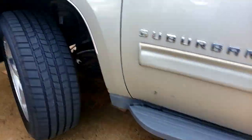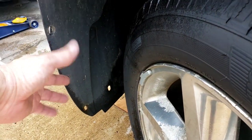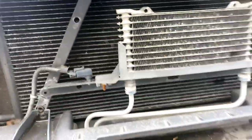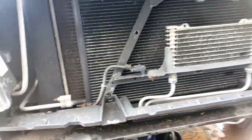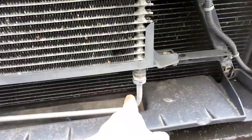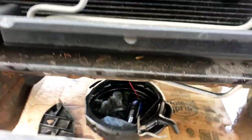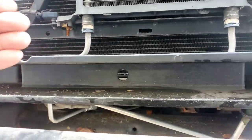When we get to the nose part of it, there's a couple of bolts over here and two clips — pop them out, bend this back. When you bend this back up on top of the fender, you will see the two holes for the 10 millimeter bolts, then the whole thing just slides right out. There's a little foam piece which comes right out. This is the oil cooler line that comes with that — you see how it slots through there. If you look underneath, you won't be able to get it through there because you're not going to be able to turn it, twist it, fish it, and come this way with it.